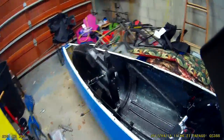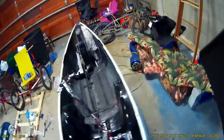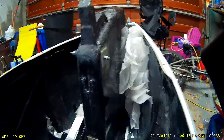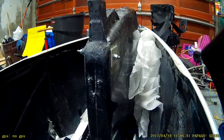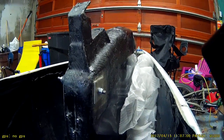One of the biggest complaints is obviously the hanger, which a lot of Quest or Strada riders really don't like — it's prone to breaking. So what I did was the modification that some users have done, which is to ditch the hanger. I used an 8mm bolt drilled through the tunnel. It's not totally aligned vertically or horizontally, but it's strong enough. I've got a double bolt on the inside of this axle to lock it in place.